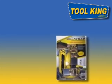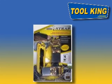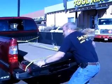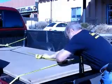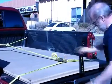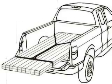Next, we have the Y-Strap. This is used to secure bundled materials totaling up to five hundred pounds. It's pretty tough — the tensile strength of the straps is actually fifteen hundred pounds. To secure a bundle of material, you fit a strap around the bundle and ratchet it tight, then hook the ends of the Y-shaped strap to anchor points near the front of your truck bed.